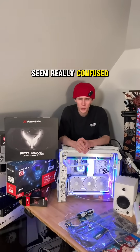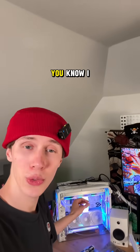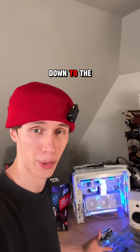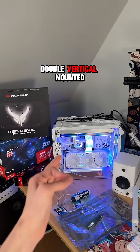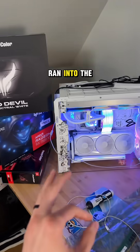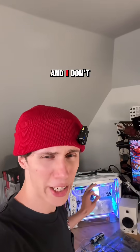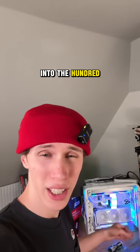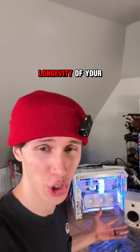A lot of people seem really confused or just didn't watch enough of my most recent video, so I'm gonna go over what I found very quickly. If you watch any of my videos, you know I had a hang-mounted GPU or a double vertical, where it hangs from the top down to the bottom. Not only have I tested many cards, but I've had quite a few double vertical-mounted GPUs, and I've never run into the problem where it causes them to nearly thermal throttle within 30 seconds. Having your GPU's hotspot go into the 100-110 degrees Celsius range is absolutely terrible for the longevity of your graphics card.